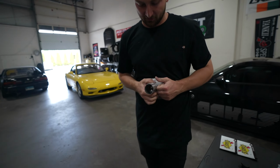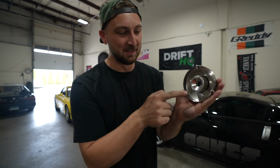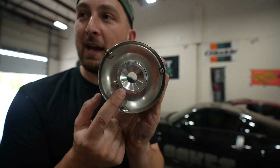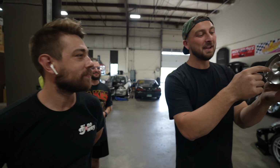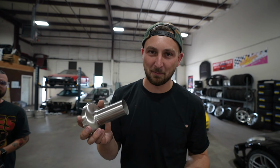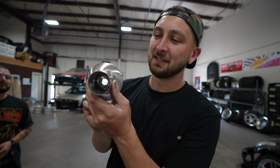Anyone who's ever gotten an aftermarket exhaust has gotten one of these things. This is a silencer to quiet your exhaust, and look, there's two levels to this thing. I've never seen one this ridiculous. Look at that. That's a moped restrictor. And you can take this out, and then you have basically that big of a hole. So all this does is restrict flow to help quiet it down. I can imagine putting this thing on will cause some issues. That's a lot of back pressure, be careful. This might not grab as much power as we think.